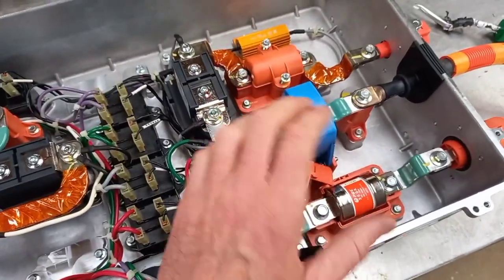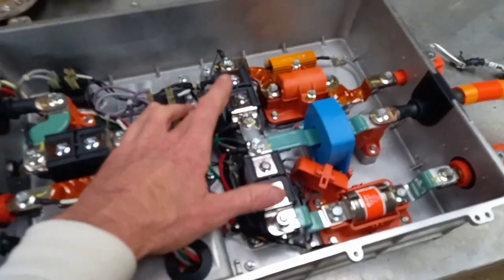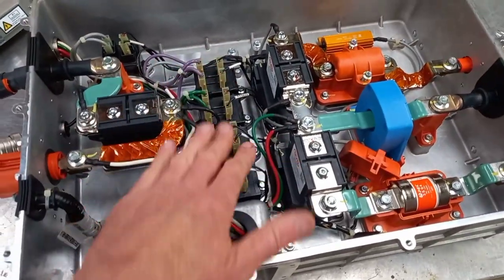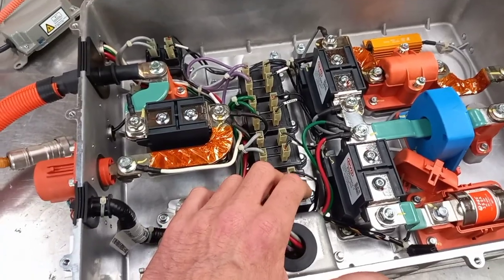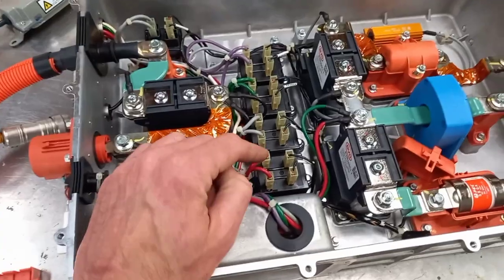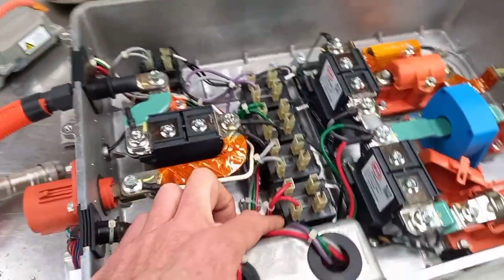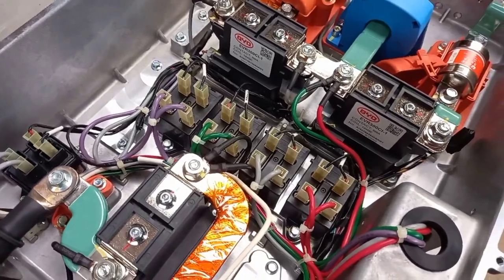And that's basically what you've got in here: two big bastard fuses, your current shunt, contactors for two sides — I'm saying charging and operating — contactor for the negative, and a bunch of relays for switching smaller current high voltage applications. These relays are obviously good for doing 400 volts, because they do get 400 volts in them, so that could be why they're such big buggers. Maybe I should take one of those out and see what it's all about.